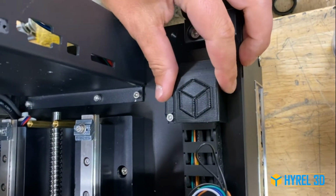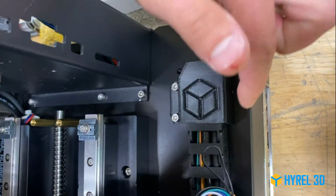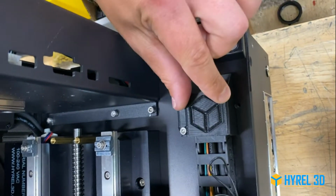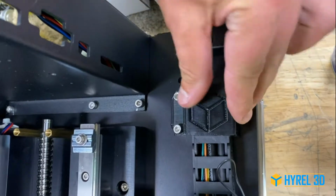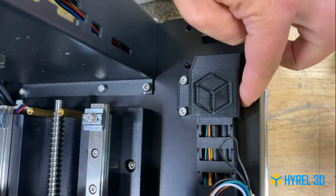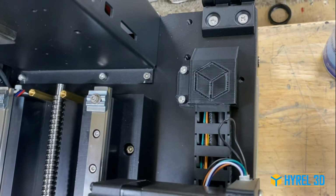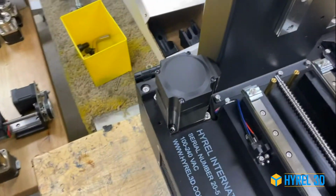If it's an old version, we do not have the top plastic cover on the cable chain. That means you're going to have easy access to your Phillips screw. If you see this kind of thing, you have to take out these 2 screws. Then you just slide your cable chain a little bit to the left, and you're going to have access to the Phillips flush mount screw. You can still use your number 2 Phillips driver. So then you're still not able to open up your base.